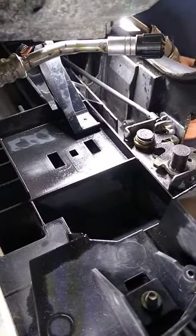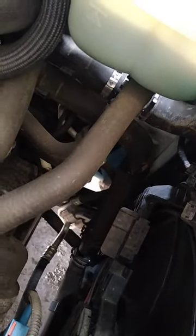That means the latch assembly is sticking. There's a similar issue on the driver side, but you cannot get to it through the fender well. You need to go underneath the vehicle and look straight up — there's just enough room to reach the latch underneath the coolant bottle. You'll need something long to get in there and release the arm assembly. Push the arm over and wedge the hood up so it actually pops while you're working on that side of the latch.